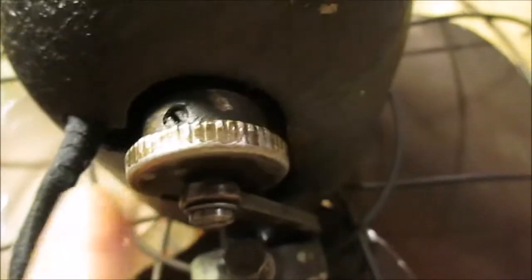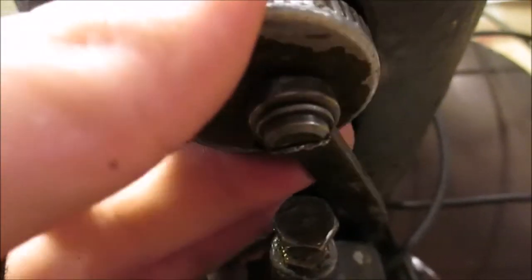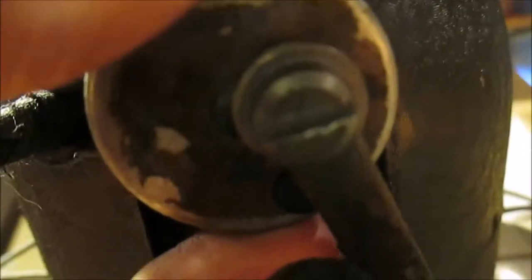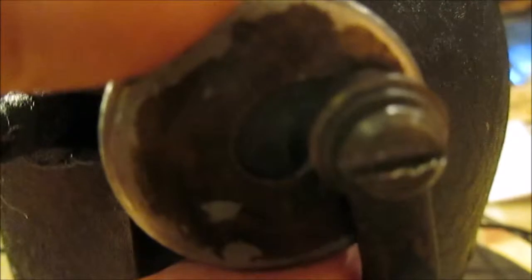And I'll show some people how to do the oscillation. This is basically the same on all Emersons that are 12 inch and 16 inches. Well, I don't know, pretty sure though. So you basically put it in the middle for it to be stationary, and it's variable, so you just turn it this way and see how it's, I'll put it straight down, see how it's moving out more. That means it's getting wider oscillation, and this is full oscillation, halfway oscillation, and very slight oscillation. And then you put it in the middle for stationary.